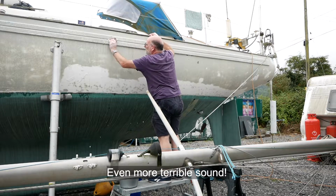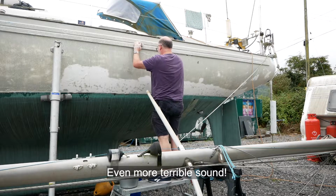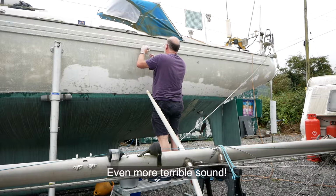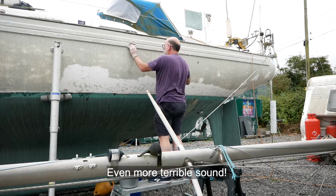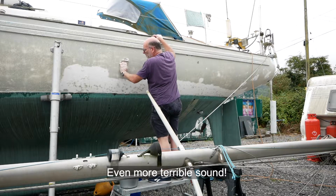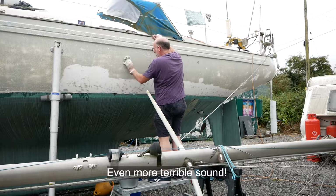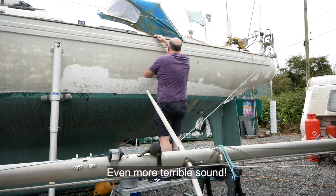Thankfully, the fact that we were able to scrape the top coat off made this a lot easier for us, although we were still very careful to wash properly. As stated, we splashed out on some [degreaser] product in a chandler rather than use soapy water. This, I think, was a good idea. The literature seems to vacillate between using soap or solvent-based products such as acetone.